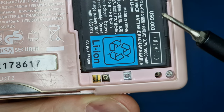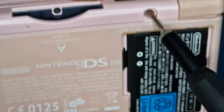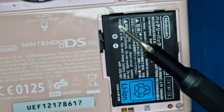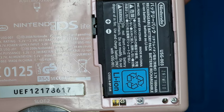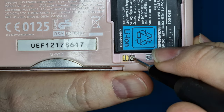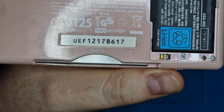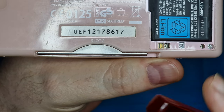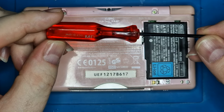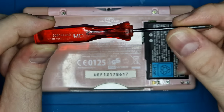Now it's really tricky to do these because this screwdriver fits perfectly for the regular screws, but unfortunately it will not turn these adjustment screws. You need to find the perfect screwdriver, otherwise you're going to strip the top off and not be able to adjust them whatsoever. I've found that this screwdriver — the one I used for Nintendo DS Lites before I got my iFixit screwdriver — works perfectly.